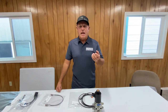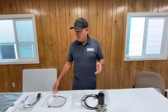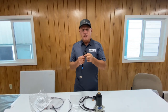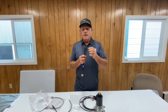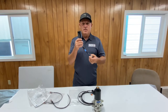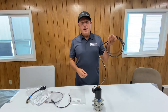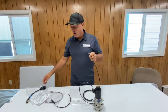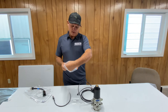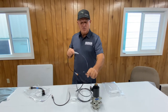If you have a Bobcat 7-pin that uses a special CAN controller: Bobcat puts a computer in every single one of their attachments. We want to save you money, so we have these little adapters. There's a 7-pin that plugs into the machine, and inside there's a microcontroller that reads the codes off the Bobcat. When you hit a button, it gives you a switched 12 volts to operate your solenoid — that's why they're expensive. You wire this the same way as before: plug it in, run the wire down your hoses. The problem is there's a female receptacle on both ends, so you need to add one of these little jumpers — a DT18, an 18-inch connector.